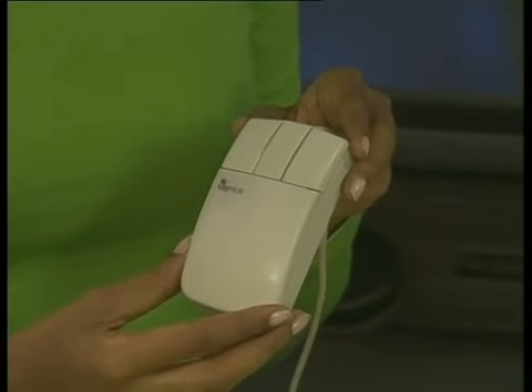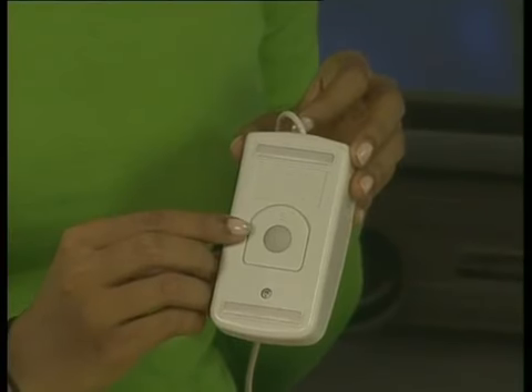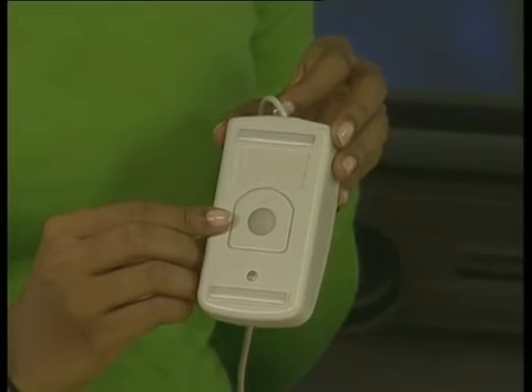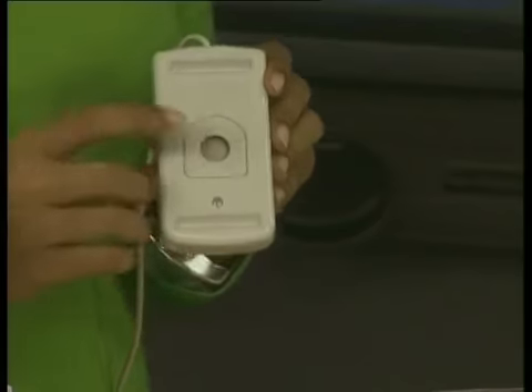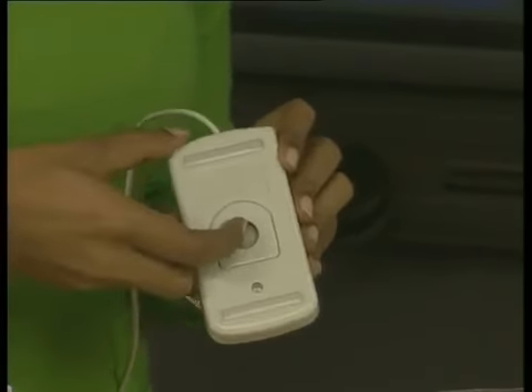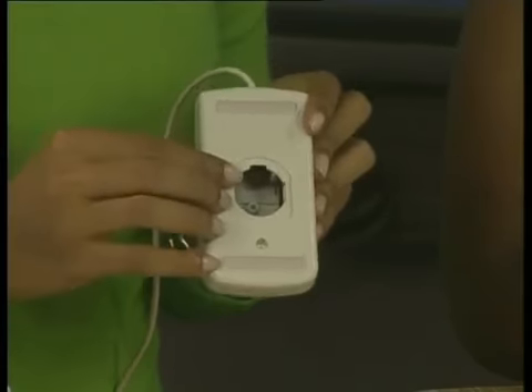Now let's look at how to clean your mouse. Always unplug your mouse before you clean it. Turn the mouse upside down to check what kind of mouse you have. This particular mouse has a ball built into the bottom — this is called a rollerball mouse. You will only be able to clean a rollerball type mouse at home; any other kind of mouse will have to be sent to a professional for maintenance. If you do have a rollerball mouse, turn it upside down and look for the small circular panel holding the ball in place. Push back in the direction the arrows point and it will click off. Take the ball out of the mouse. When you look inside the mouse, you will see a lot of dust and dirt collected on the rollers, which can interfere with the way the mouse moves and must be cleaned off.